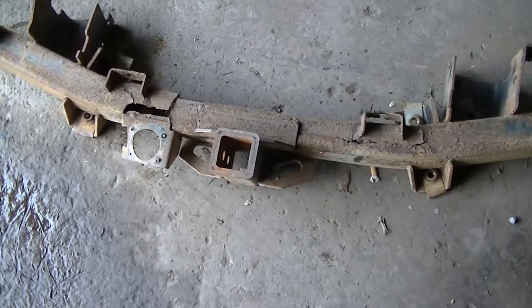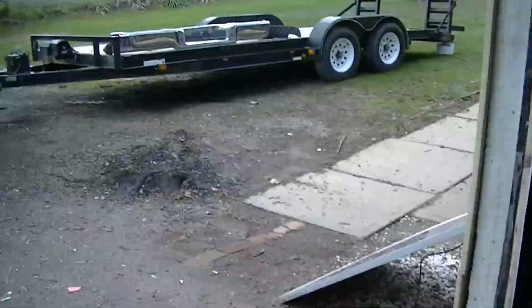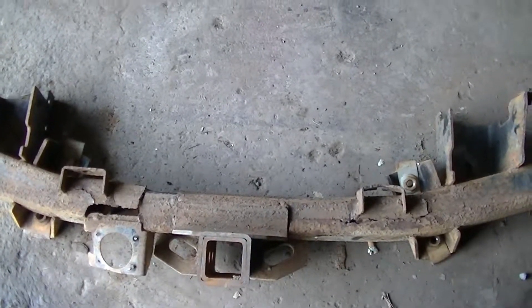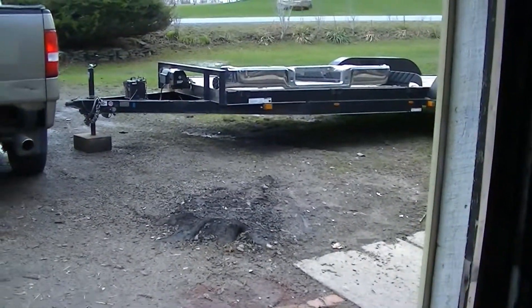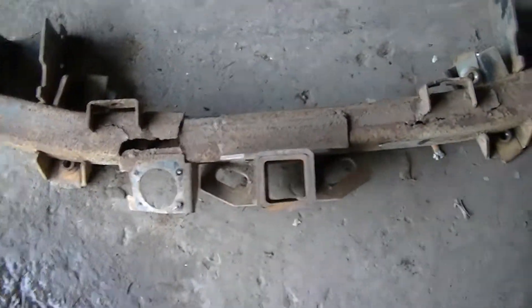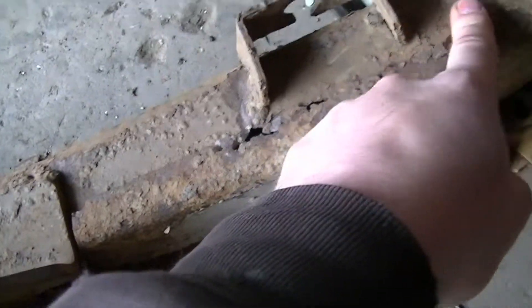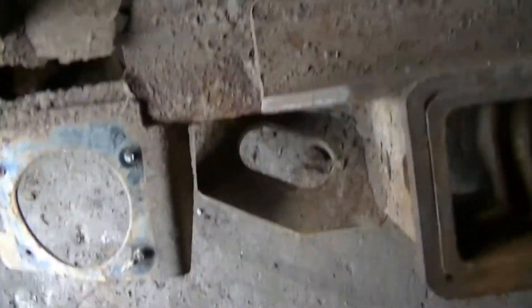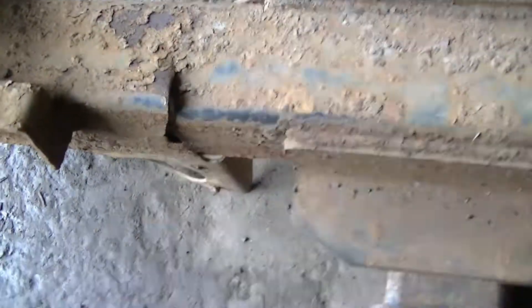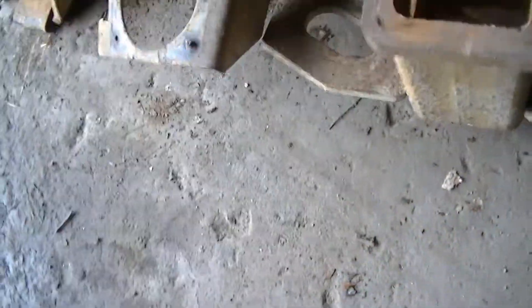I just pulled this off my truck. Yesterday I was towing my 18-footer dovetail equipment trailer, 7,000 pound GVW. This is the hitch off the back of my truck. I got it off — in the bumper over there on the trailer. We had a little bit of rot. As you can see here, it's pretty soft. And then we had it actually tear right there — this tore on the way to the trailer. And this happened when the trailer was empty, so this is pretty rotted.